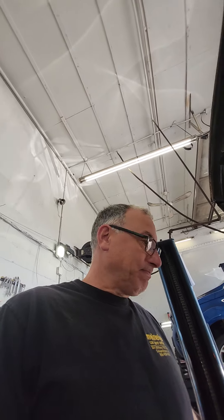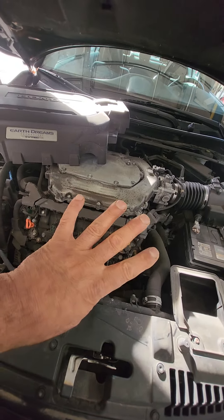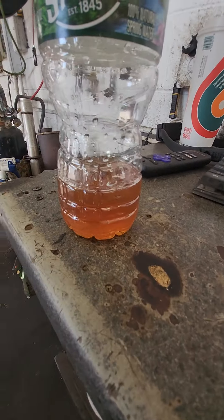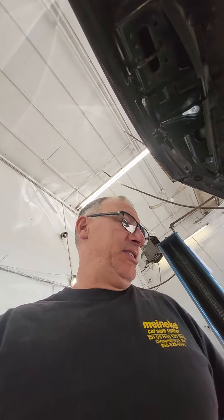Oil can only hold so many contaminants before it's horrible — that's why engine oil turns black, brown, or other colors in the spectrum. You have to get a gauge on what's going on. You can't just say you're going to drive it 8,000 to 10,000 miles — that's way overdue, and we've proven that thousands of times. This engine doesn't have oil consumption. At 4,000 miles our 5W-20 synthetic blend looks very similar to fresh oil. If this customer had to push it, could he? I wouldn't advise it. You have to test — if you don't test, you're asking for a big bill for engine replacement.